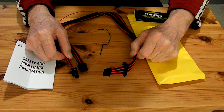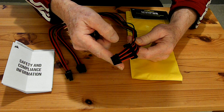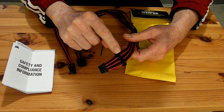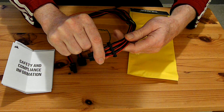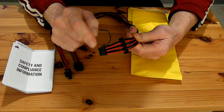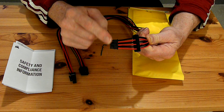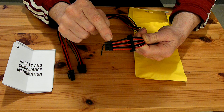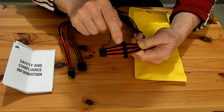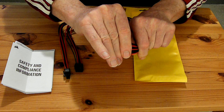This cable is designed for delivering 600 watts over two strands — two separate power connectors — from the 16-pin power connector at the GPU. The nice thing about this cable that the cheaper ribbon cable does not have is this block. This is a cable block, designed to prevent you from bending the cable too close to the power connector, which has caused a lot of issues with people melting their GPUs or cables because of stress on the connector, or not fully inserting the connector into the 4000 series GPU. Corsair has intelligently put this suggested minimum bend distance here — about two inches from the actual connector — and you should bend there after and down.